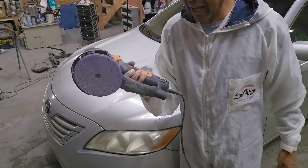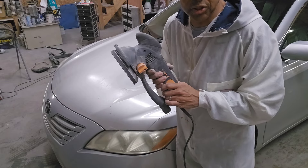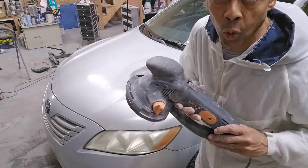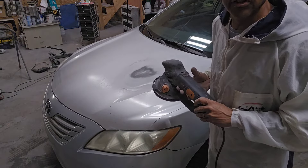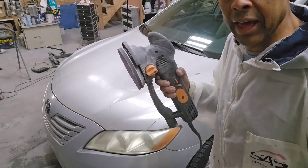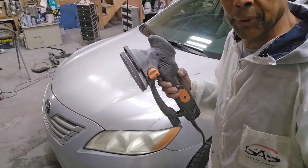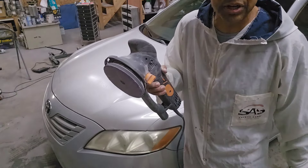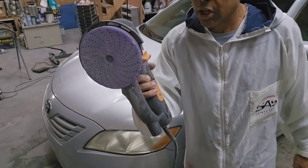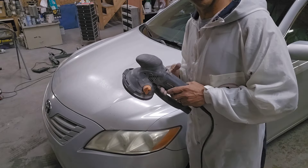I do feel that it is still moving circular when you turn it down to DA mode, and you're able to control it. With that ability to flip this switch and take it off 100% direct drive mode, I find that this is a lot easier to control when you're working on the job. Plus I'm not worried about using and tearing up my compressor or listening to all that noise from the shop compressor running to get through a car — when I'm taking down paint on an entire car I'm just beating up that compressor and running it half the night. I don't have to listen to that when I'm using an electric DA.